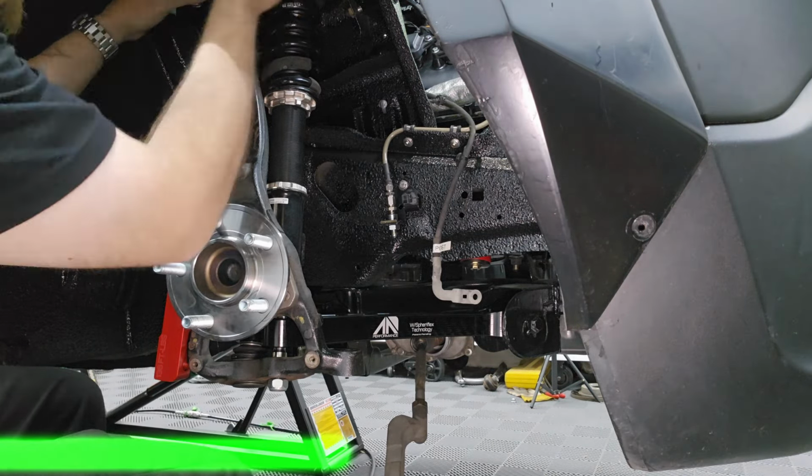But on that note, I am working on rear shock mounts. I did a little quick test piece. This fits, unfortunately, the factory charcoal canister for the EVAP system does not fit. They both take up the same space. So we're gonna have to do something about this. This is actually the canister from the Renegade. It bolts right into factory spots, but it's massive. It's right in the way.